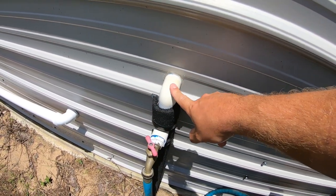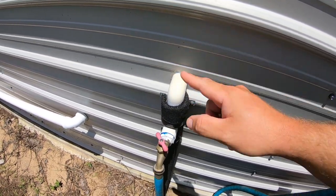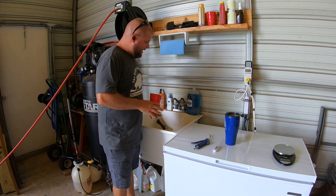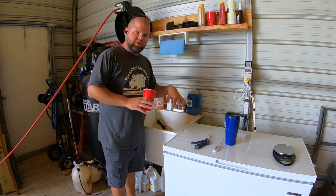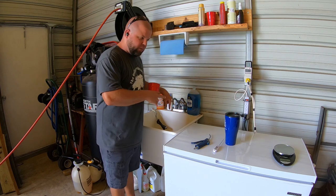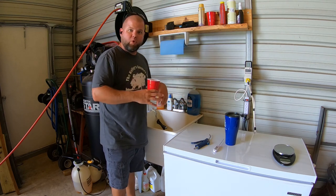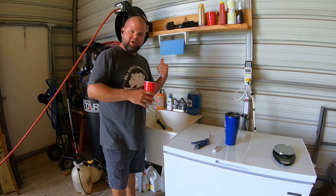Touching this pipe up here, it's hot — I'm getting extremely hot water inside. We're going to pull a couple samples and check the temperature. I think we can make a dramatic improvement out here by reflecting some heat away. Now, the water I pull from outside is probably going to be hotter than what's actually making it to the ice makers. The reason why they only run for five seconds — I've timed them — there's a filter down there full of water plus a decent length of line, so it pulls some of that hot water inside after a cycle, then starts cooling down to room temperature. It's quite hot in here, but a lot less hot than out there sitting in the sun in the pipe.